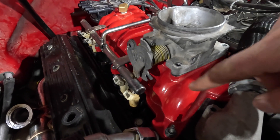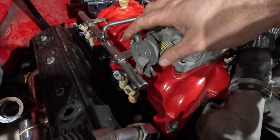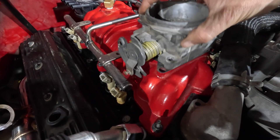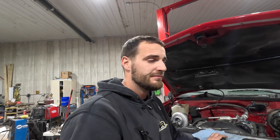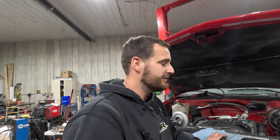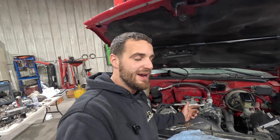The next thing to address is this throttle body issue — there's a gap and it will not seal. Unfortunately I threw away the marine throttle body that may or may not have worked. It turns out that throttle body is going for over $200 on eBay. What a stupid mistake — I should have checked. Now I just need to find a solution for the throttle body hitting the fuel rail.